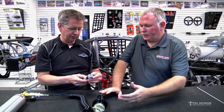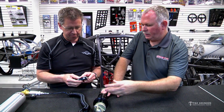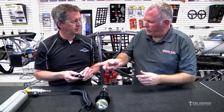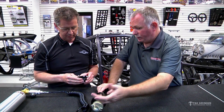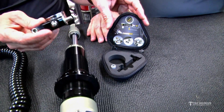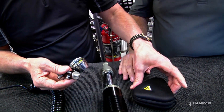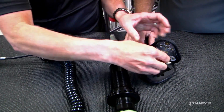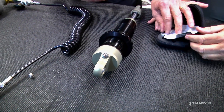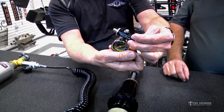I always like to go just a little bit above my number because I'm going to lose just a hair when I take this off. Even though it works really well, when you unscrew it you'll hear just a little hiss and lose a slight amount. I typically overshoot by five pounds — so if you want 75, be at 80. When you take it off, if you stick it right back on there, it'll read 76 pounds on a remote canister shock; this piggyback style would be exactly 75. It loses four to five pounds — just the small volume inside the Schrader. This gauge comes in a nice little carrying case — keep it in there because it needs to be accurate. You can find it on our website; it works really well, and as you're under the car you can spin it around to get the gauge exactly where you can see it.